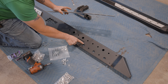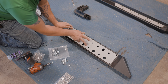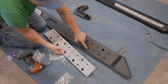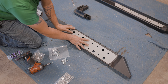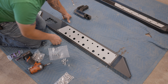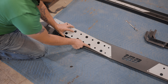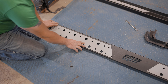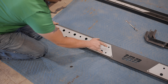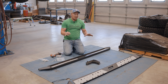This is going to be the rear because we have our directional indicator here, and the countersunk holes are there. The two parallel smaller holes are our mounting holes where the bracket attaches — the rear of the step has one mounting bracket, the front has two. At the front of the step there's no Frontier cutout; we have one countersunk hole and two mounting points with smaller holes. Make sure the countersunk side faces up and both mounting points are lined up, then repeat on the other step.